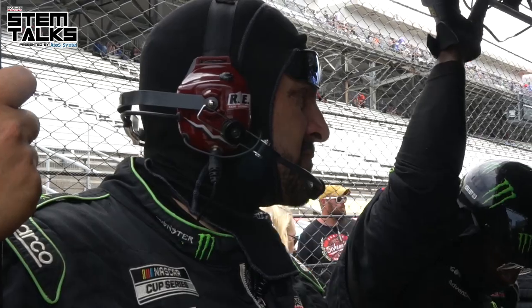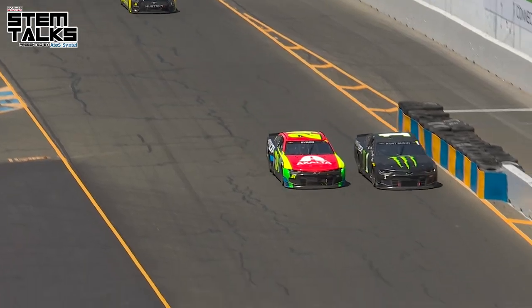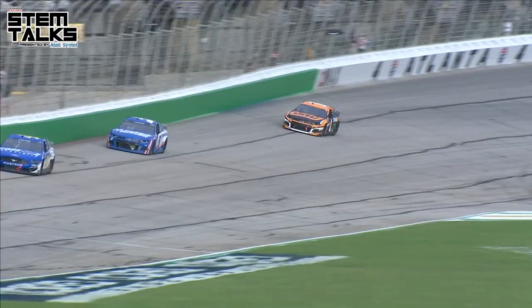Today we're going to talk about tire pressures. The gauge is very critical for when we set everything up — it's a digital gauge. What we're going to do is show how you set the tire pressures at the beginning, and then what we check after a run, because how much the tire builds is going to be very critical on how the car performs on the track and whether it's too much bite or not enough bite.